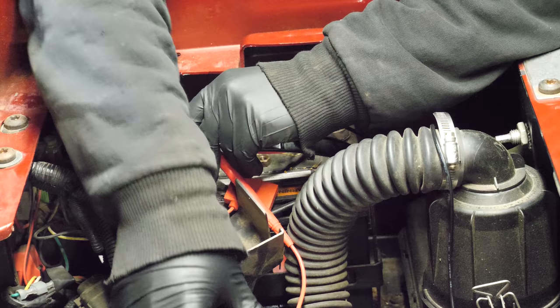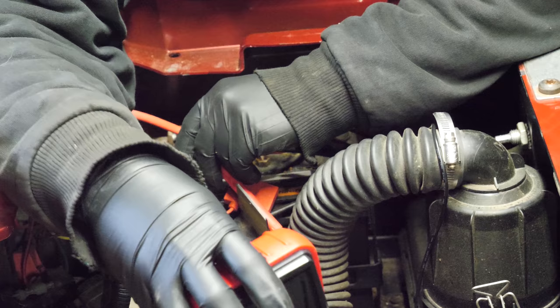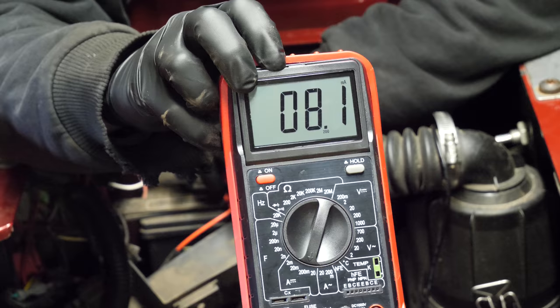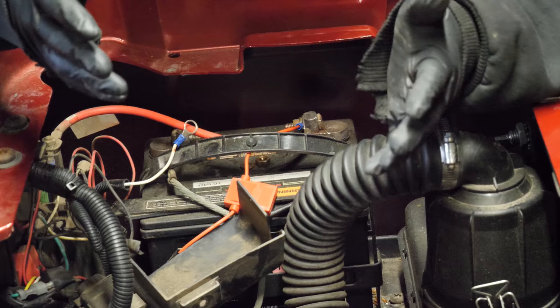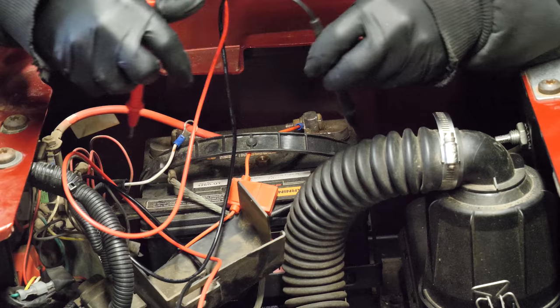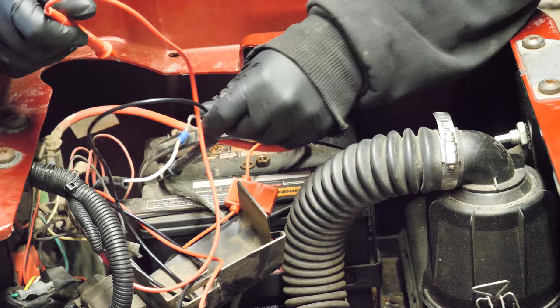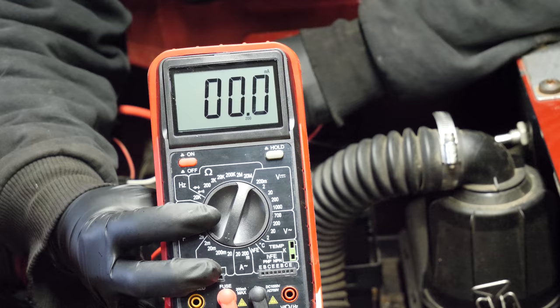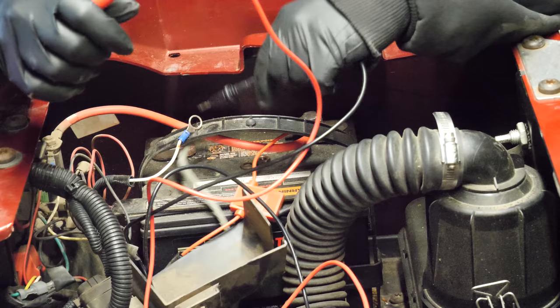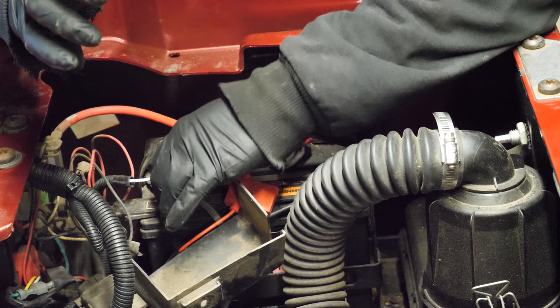On the lighting circuit, there should be absolutely none — no draw whatsoever. But you can see here there's an 8 milliamp draw on the lighting circuit. That's why this battery keeps going dead on this cart. That should be zero. Now let's go to the cart side — I'm just going to stab the braided wire and go to our negative terminal on the battery. Zero. That is zero milliamps being constantly drawn. So there is something in the lighting circuit that is keeping this battery dead. It continuously is drawing the battery down.